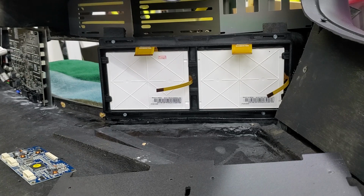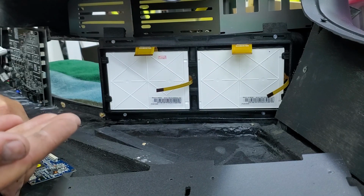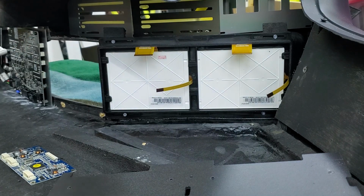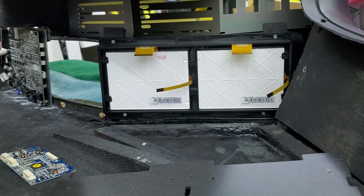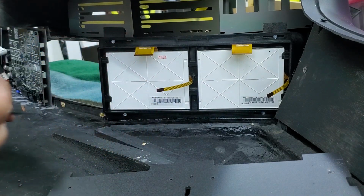Now what you're going to need, you're going to need 8 screws. I like to use the M3 3mm screws. These are 1/4 inch, and they will work just fine for what we're doing. So you'll get 8 of those. Sorry, you're going to use 16 of those. And then you're going to use 8 M3 spacers. I'd use 8mm. You can use 4mm if you want, or 7mm, doesn't really matter. But you do need to make sure that you adjust the length of your screws. So for my purpose, I use M3 8mm nylon spacers. Nylon because you don't have any worry about metal making contact.